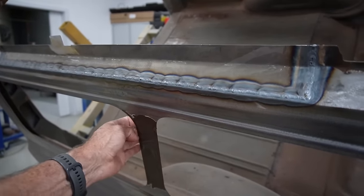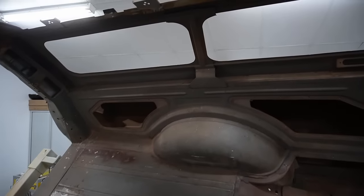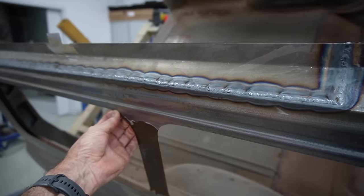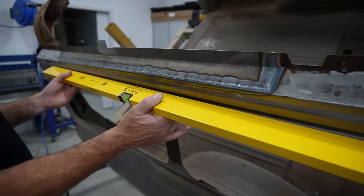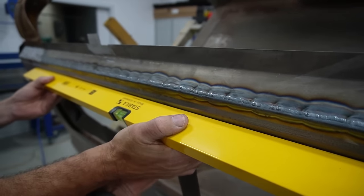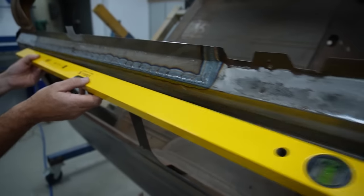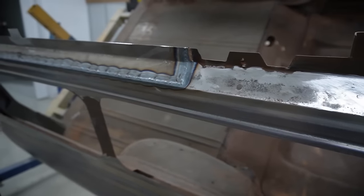This center bar here has got a bracing behind it, like that one up there. But it had come off previous to us even working on the car, and I didn't really think to clamp it, because I'm going to remove those when I get rid of the windows. But you'll see here, when you put a straight edge along there and pull that up tight to the bracket, there's nothing in it. But if you just let go of the bracket, you can see how much that moves. So it's all very light, it's only 1 mil, and it's very easy to move without the structure in place.